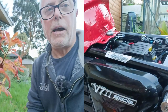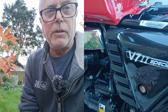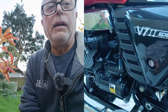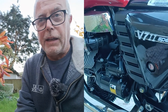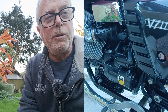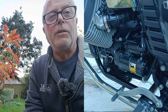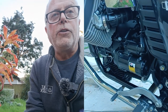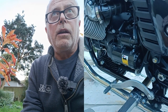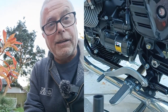I haven't checked the torque settings as yet but I will do that. The next thing to do is start pouring in the oil. I'm going to be very cautious about how I do this because once you overfill the oil it's a damn pain to try and get it out again. This may be rather more slow and cumbersome than a professionally trained person would do it, but I know I'm a clumsy-fingered man who gets things wrong. Caution is the watchword. Get it up to a mark, run the engine for a minute to get the oil into the filter, wait a while, then check again and again until I get it right.